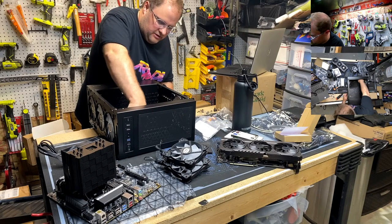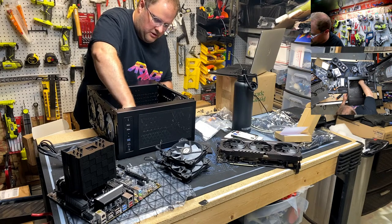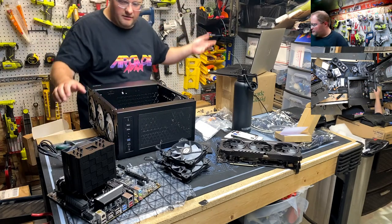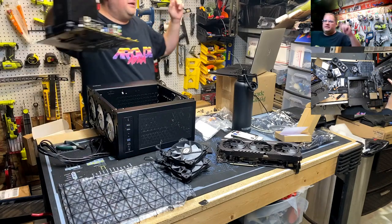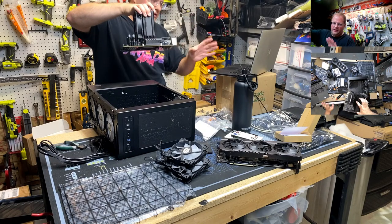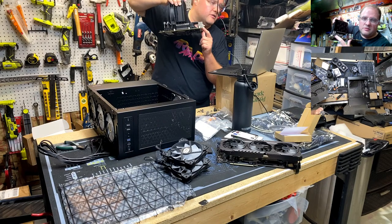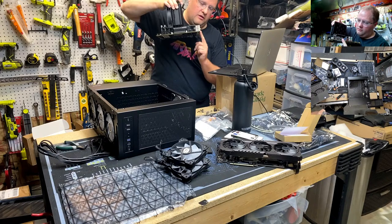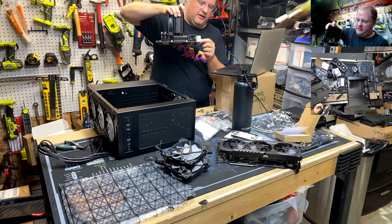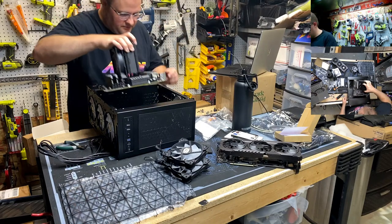Oh, and Scan, you mentioned streaming with this thing. I got you the full fat K processor because it has video output built into the processor itself. So that helps with video decoding and encoding. It's called NVENC on Intel. Or no, that's NVIDIA's. Intel's got the H.264 and H.265 hardware. Anyway, nerdy stuff. Point being, if you have video card problems, your motherboard has HDMI and DisplayPort output, so we can troubleshoot with these. But otherwise, you should never use these intentionally. Like, don't put the marquee in here. Don't put your secondary display in here. Always go through your video card.